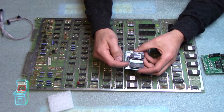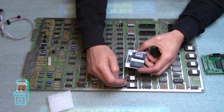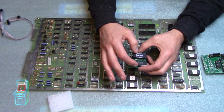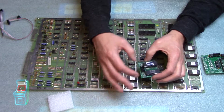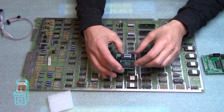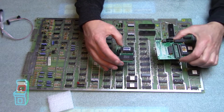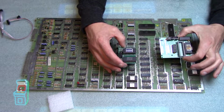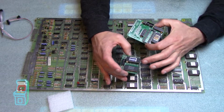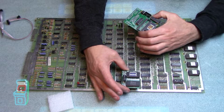So you see how the notches are facing this side of the board where the edge connectors are. So are these right here, so that you want to put them in the same direction. Because this is actually replacing the ROMs for here, but it's also depending on what part of memory it's in. And this here controls like, okay, you select whatever game it is, and then it switches this ROM into here because these are smaller, and the 27C512s hold more. So there it is right there.